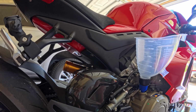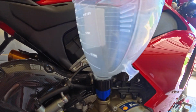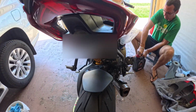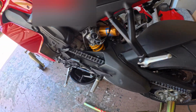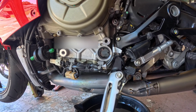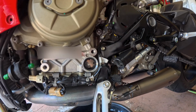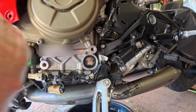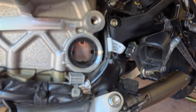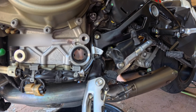Do you want to go to the other side and watch in the sight glass? So this is where it comes handy to have two people, because I'll have a little camera lady go over to the other side and watch in the sight glass and let me know when it's getting full. And I'm probably going to fill it up to the top bar, and then I'll run it and let it sit overnight. So again, we're going to fill it to this top bar and let it run, and then let it sit overnight. You ready? Yeah. Okay.